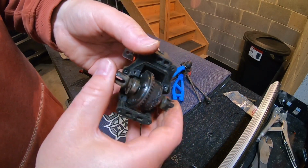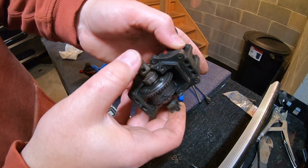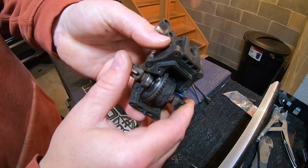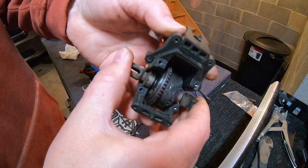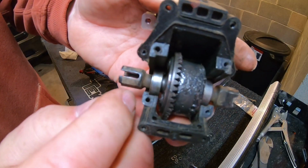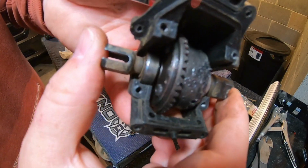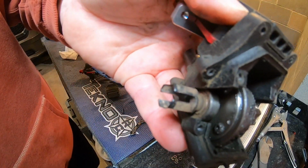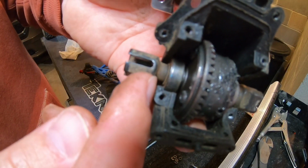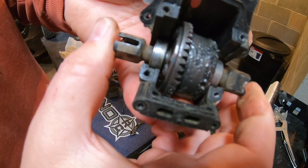side to side. And when you slide this down, it's easiest to set them on their side so the shim is wanting to lay on the bearing. You'll feel it's a little snug going in there. Once it's seated, and you slide that bearing the rest of the way down in that little seat, there's a little slit right beside the bearing. That's the gap you want to fill up right in here. You don't want it on the outside. You want to make sure it's tucked in with the bearing and on the case, but you should not have any play from side to side then.